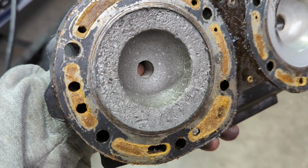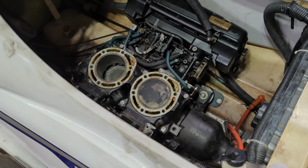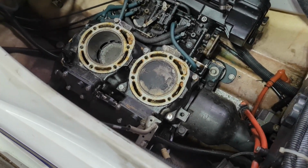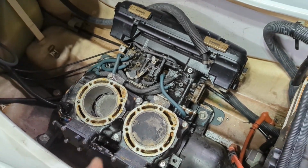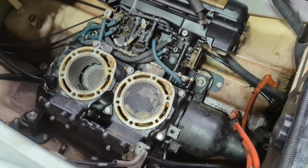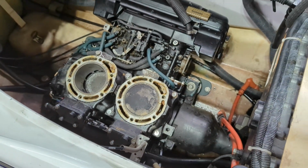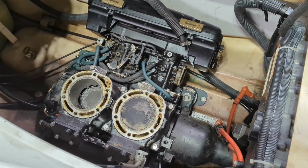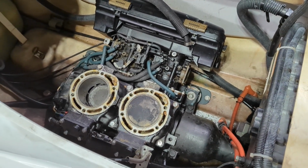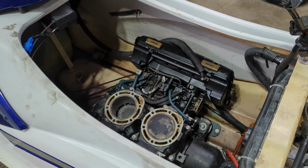We'll find hopefully what that is and figure out how to get this thing fixed. All right, so I'm this close now. I think for me, I really do want to get this engine out of here. So I'm probably going to take this air box off, and then the power valve control cables right here, I'm going to take those both off. And you know, there'll be miscellaneous throttle and things to take loose, but generally it should come out pretty easy now. I just want to have this working on a bench rather than bent over into the hull of this thing.